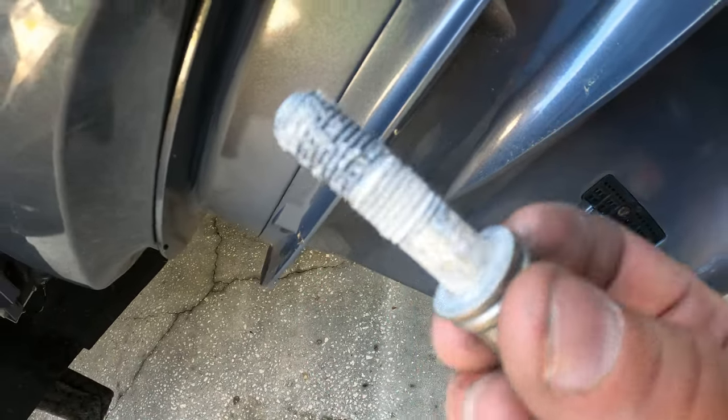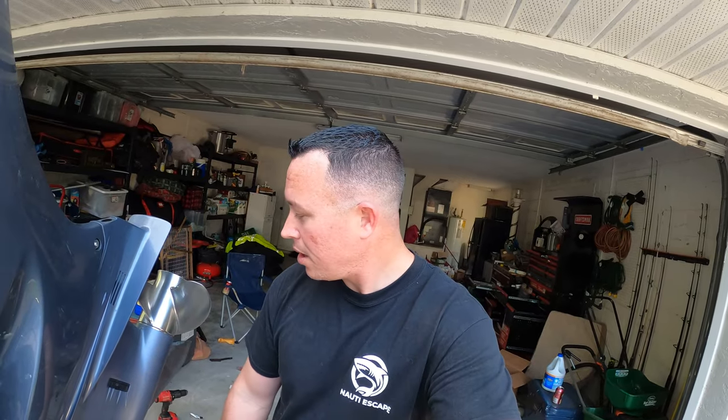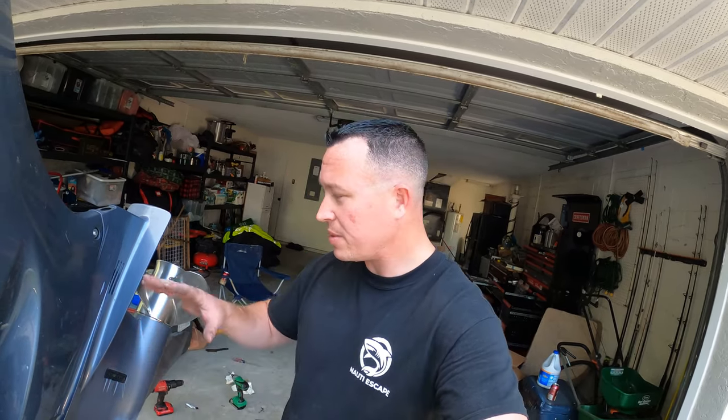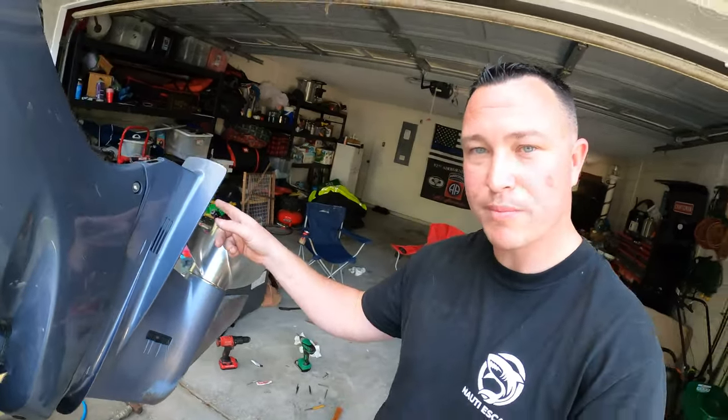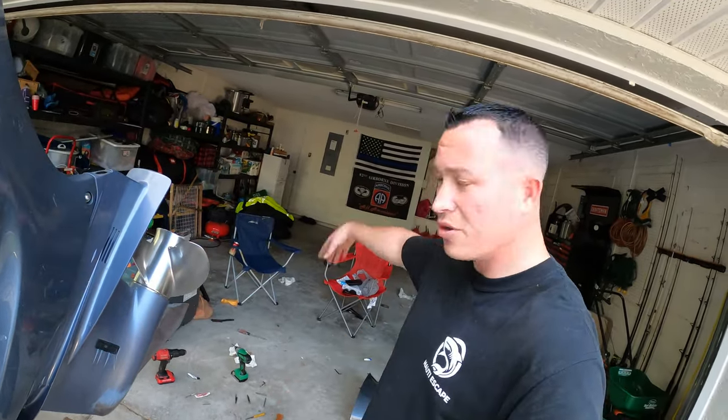See how crusty all that is? Before you put these back on, take a wire brush and get all that crud off, then remember to put some anti-seize on there. That way when you do your next service, it'll come off much smoother and easier, and you don't have to keep spraying PB Blaster on them. I'm going to set the camera up so you can watch me take this out. There's still one bolt to remove, then you just jiggle it and the whole unit will come out in one piece, and we'll set it on a chair while we set up for the water pump kit.